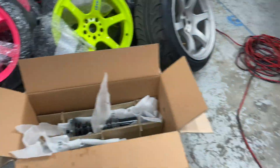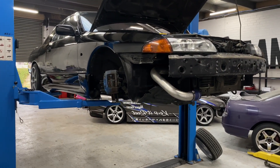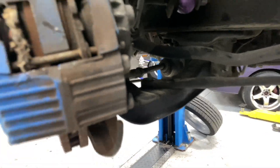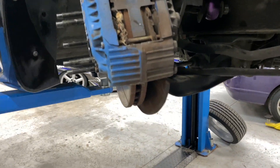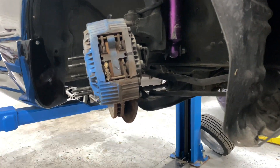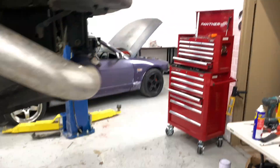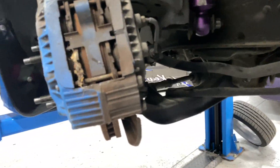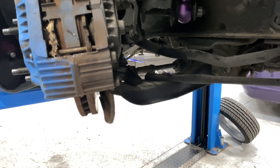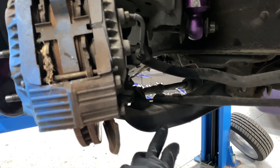Alright, I'll let Gary do his thing and we'll be back for some camber mods. I've got the R32 on the hoist ready to pull out the lower control arms. Going to put in 15mm extended LCAs done by Tori from Kamikaze Fab about two and a half years ago. We thought about using the ones from the 33 but measuring them up, there's only about 5mm total difference stock-for-stock, so putting the 15mm ones in is really going to be like extending 20mm.